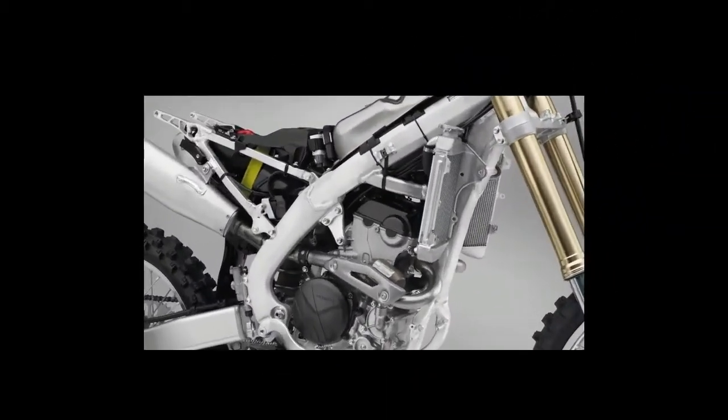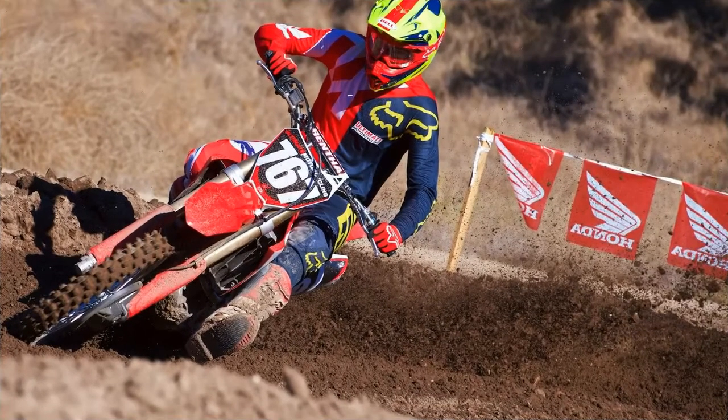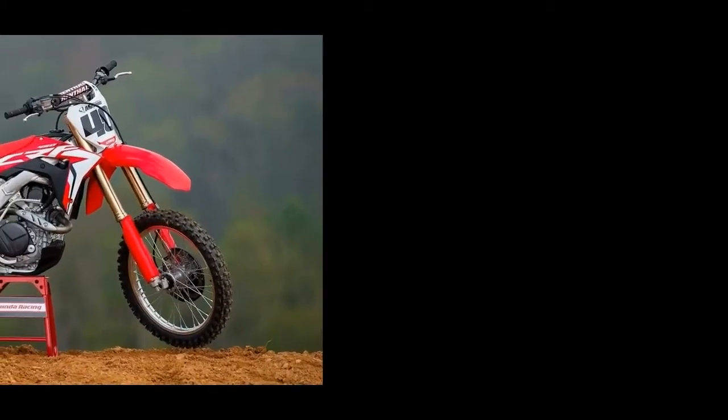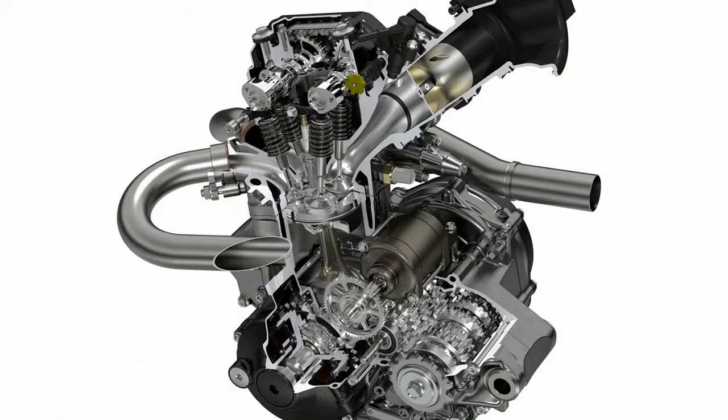Honda recommends 105mm of sag as a baseline setting, but the bike seems to work better with a little more sag. I went as high as 109mm per the recommendation of one of the Honda technicians, which made the bike feel more stable at high speeds. Overall, the new Showa suspension components saw a huge improvement over the previous setup and are a win-win in the front and rear.